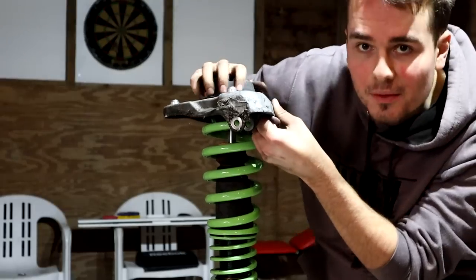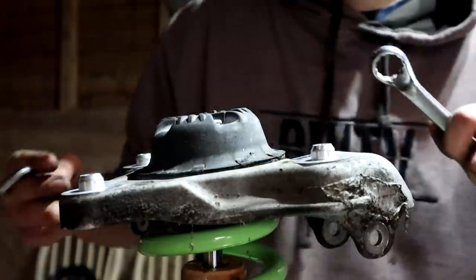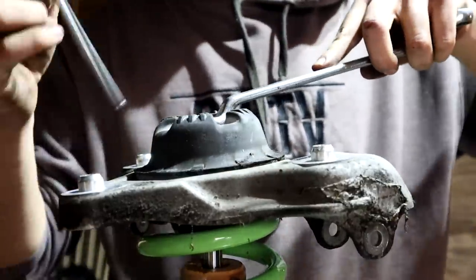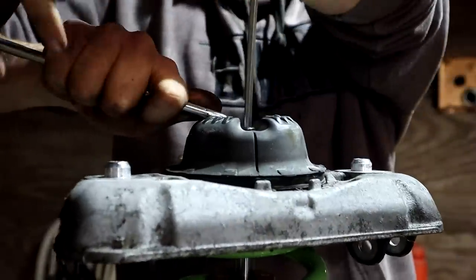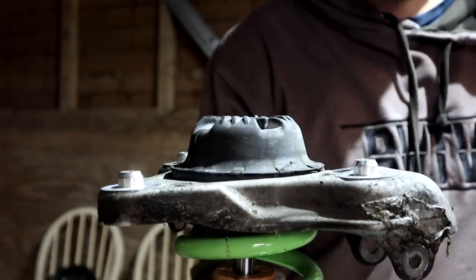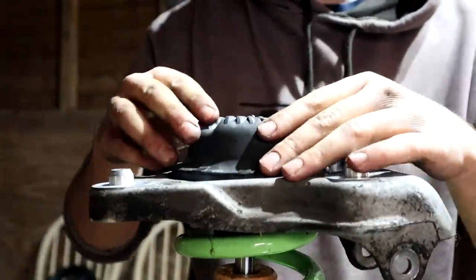And it kind of clips in, and then the nut goes on top of that. And for some reason, installation to put it back on, the new nut is 19mm and you need a 5mm Allen key. This is where, if you had an impact gun, you could do a few bursts to make sure that's all nice and tight, but I don't have one, so I can't do that.